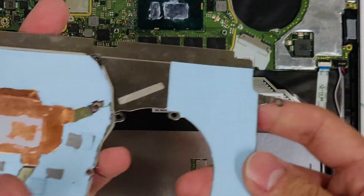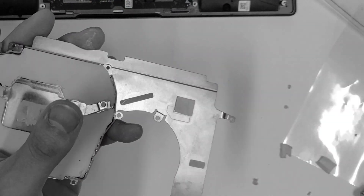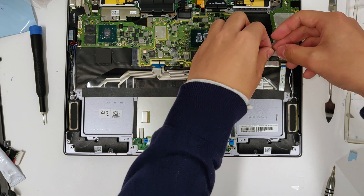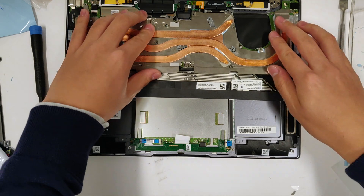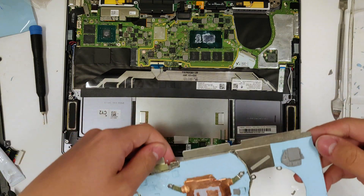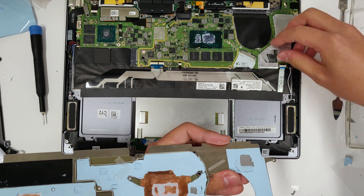Now there's one thing we haven't done yet: the big inductor for charging and the little MOSFET surrounding it. Remember peeling off their original thermal pads? It's time to give them new ones. Slap the heatsink on there one more time — these pads should stick and get picked up by the big blue pad. Cut out that section, and of course put the pads for charging back.